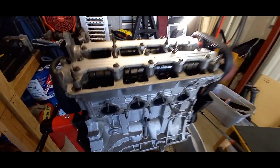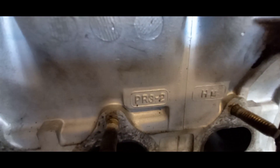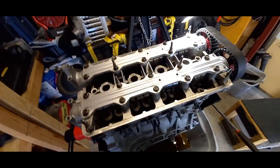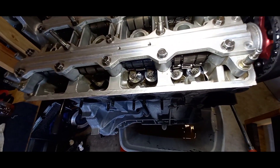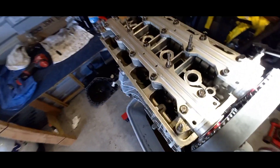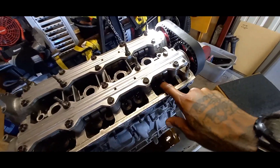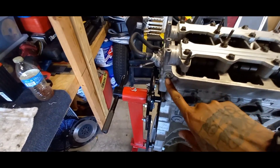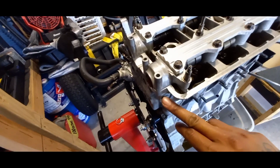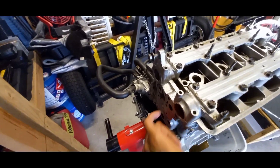What I got here is the B16 head on — it's a '91 head, a PR3-2, so this is a JDM B16 out of a CRX. I went ahead and locked VTEC on cylinder one on the exhaust side and on the intake side as well. There's a pin that goes across from pressure. Since I don't have the air pressure hose to lock the VTEC in with like 60 PSI, I used these rods that hold the rockers in place.